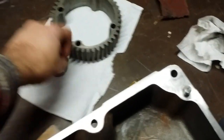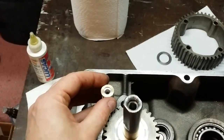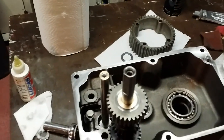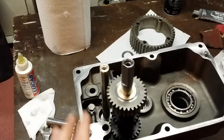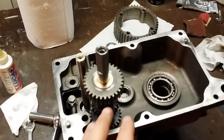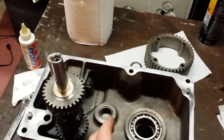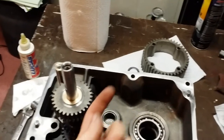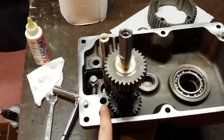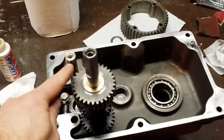And now this one gets a little tricky because you've got to do a balancing act on the top of this particular shaft in order for it to fit inside the bearing cup. Now, if I were doing final assembly, I would put a little touch of bearing grease right there just to glue it all together and make it stay put while I put the other case on. The reason for that is I would be trying to line up a whole bunch of different shafts: this one through the case, the big, huge primary shaft and gear in the opposing case, because those bearings are both closed. Plus, at that point, I'll also have the reverse gear shaft in place. So trying to get it all lined up, I'm going to have to twist and bend and line everything up, and that washer would always fall off.